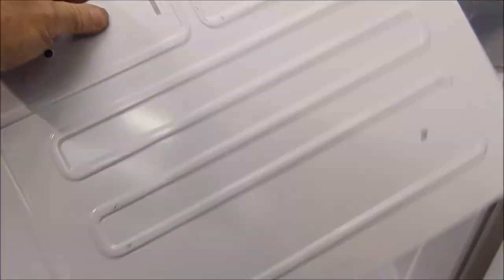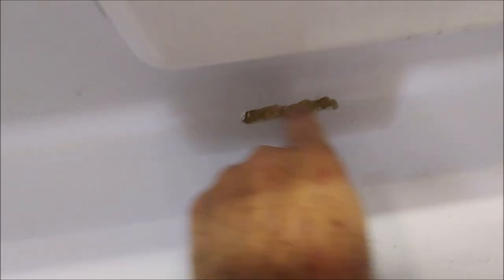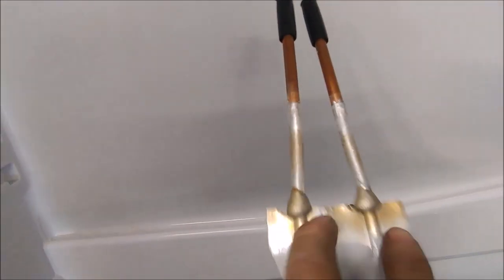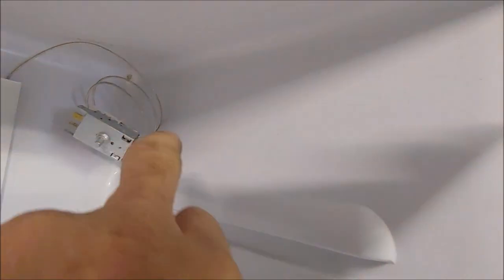This is the cold plate I'm going to put in — it's made out of aluminium. One side was painted and the back wasn't, so I took it outside and with a spray can painted a little bit on it to stop corrosion from forming. I'm going to make a hole in the top and put the pipes through to the back. I've cut a little slot into the fridge with a drill bit, moving it up and down the length of the cold plate's shoulder, which I'm going to stick through there. I've mounted the cold plate with four self-tapping screws, made a bracket for the thermostat bulb, and I'll put a little box here with a knob for them to adjust the temperature.